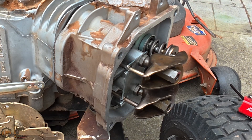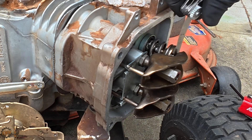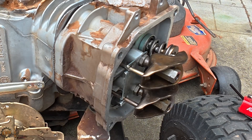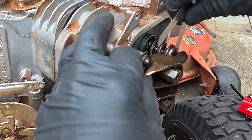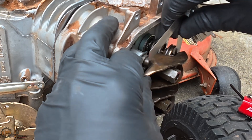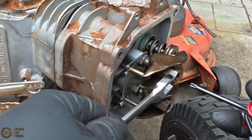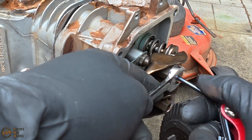Let's go to the 0.004. So we've got drag on 0.004. Our 0.005 is a little tight. You could call that good if you want — I'm just going to loosen it up just a hair.